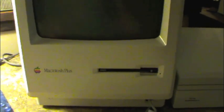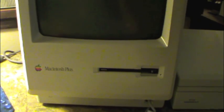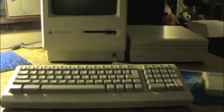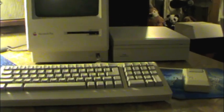So, since there is no internal hard disk drive, the Mac Plus has to make do with an 800K variable speed floppy disk drive. It is double-sided. Unfortunately, I can no longer read these on anything I have, except for my genuine Apple computers or my Macintosh PowerBooks. I tried copying a file to a brand new 720K disk formatted as an 800, and I couldn't do it because my external USB floppy drive won't support the multi-speed function. Oh well.